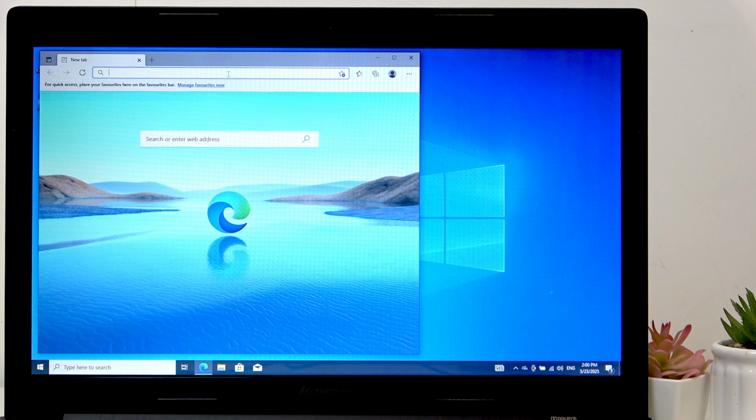And before we begin, you need 2 to 3 things. The first two are a USB drive that's at least 8 gigabytes, but it can be 16 and it'll be better. But it doesn't really matter. I believe that 8 gigabytes at least is like the minimum. It can be gotten for really cheap these days. And then also a charger. Your laptop has to be plugged in during the whole process, because you may break something if it's in the process of doing something and it discharges.